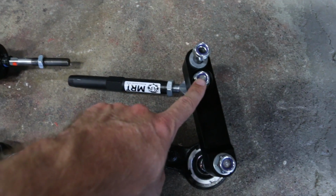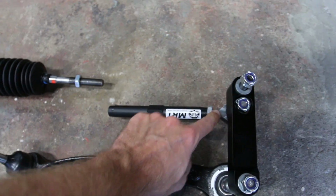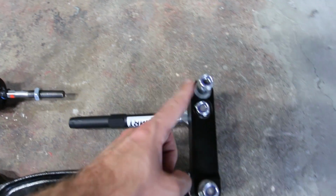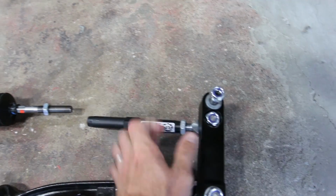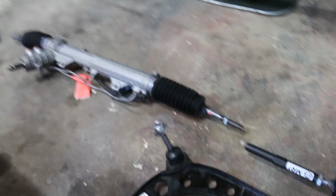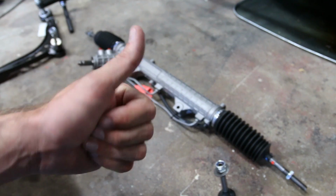Also, this changes the pickup point for the actual tie rod itself. So normally this would hook on right here, basically where the knuckle is, and that's going to give you a longer stroke. This actually shortens the stroke, increasing steering angle and also increasing the speed at which the wheel turns. So this is gonna make this thing super tight. It's just gonna be amazing. It's gonna point and shoot and be freaking sweet. So that'll be in the next video, all this stuff. So look forward to seeing that.